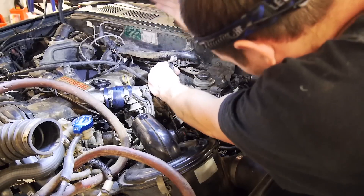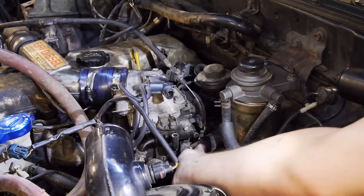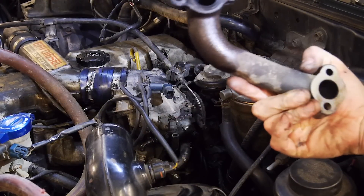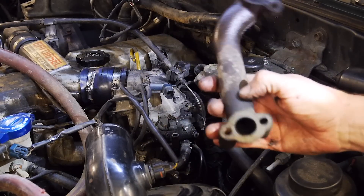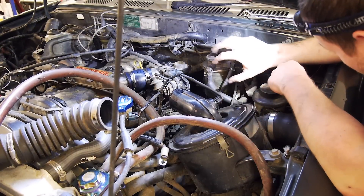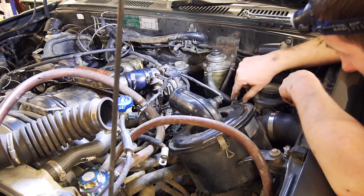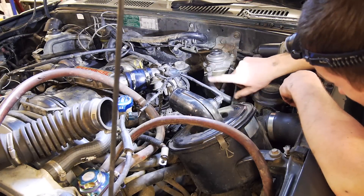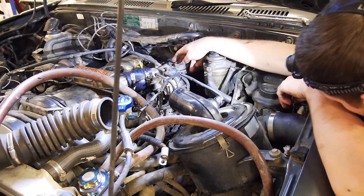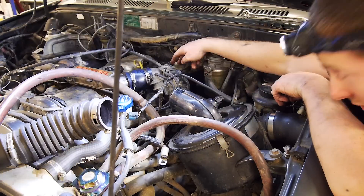All right, moment of truth — that's good, very good. This piece of crap should just pop straight off. There we go — so there's the EGR pipe, stupid thing. It's kind of hard to get footage of this, but if you're actually doing it to your car you'll be able to work it out pretty easily. With that pipe off, you can now gain access to the bolts that mount the EGR valve in place — looks like there are three of them, 12 mil heads.